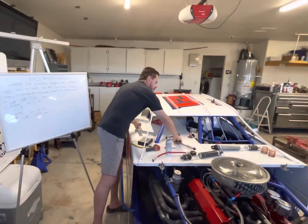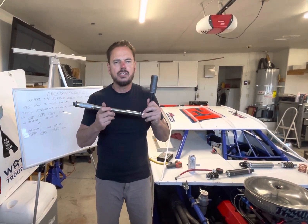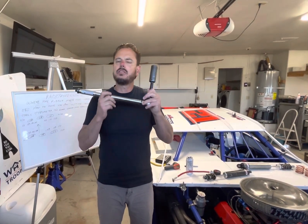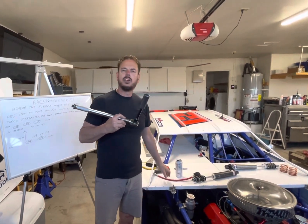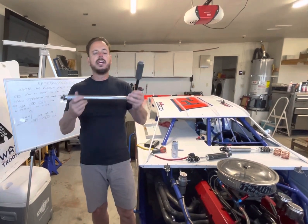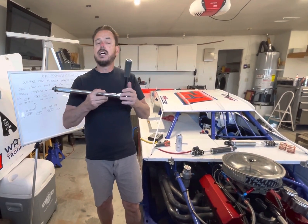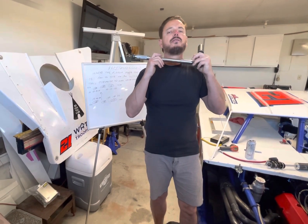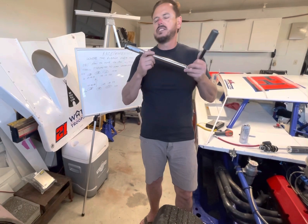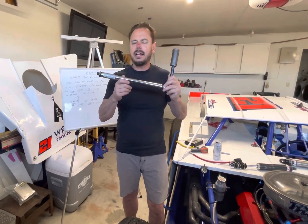The last and most important tool — if you remember one thing from today's video — is your torque wrench for your lugs. You need to torque your lugs on your car every time you go out. Before you go out, there are two things your crew must do: one, set your pressures; two, torque your wheels. I've destroyed two cars in 30 years — very expensive — just because guys thought the wheels were tight, but it turns out the battery was dead on the impact gun. So go buy a cheap one from Harbor Freight, set it at 60–65 pounds — that's close enough. Get yourself an extension and a one-inch socket. Have a backup. I've got backups on the trailer too.